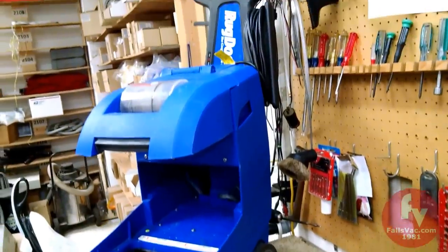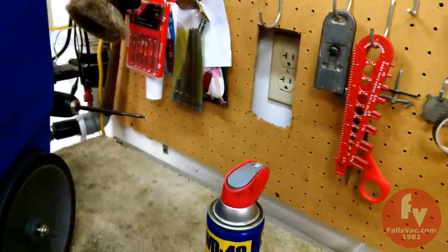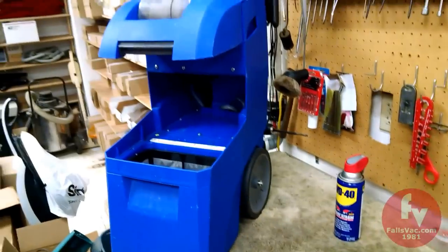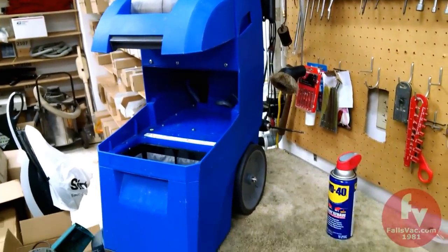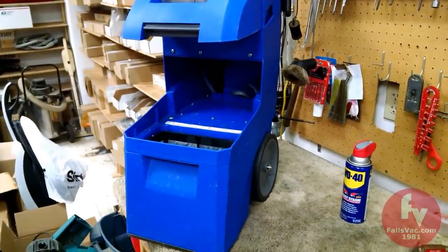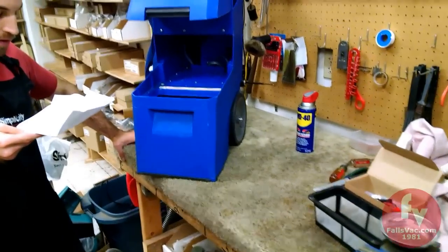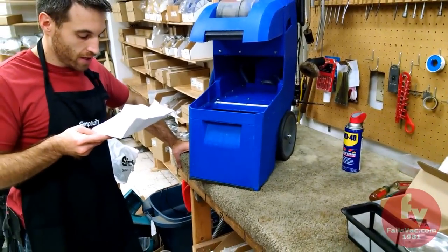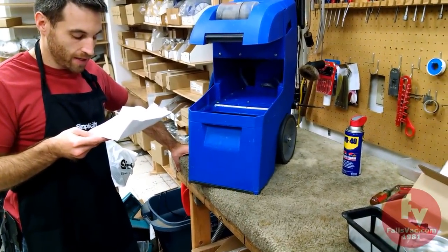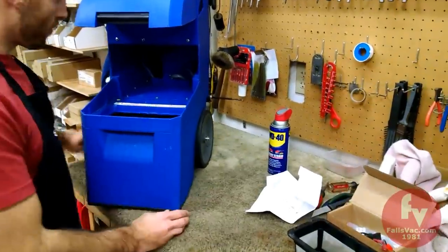Common sense. Failure to disconnect power could result in an electrical shock hazard. So we are not plugged in. We remove the white recovery bucket. Now that's step two. Remove the filler basket. Step four is to pull several inches of suction line up into the area behind the quick coupler to reduce tension on the suction hose.